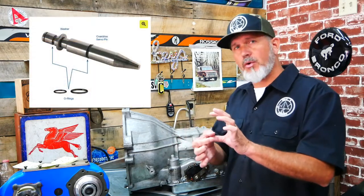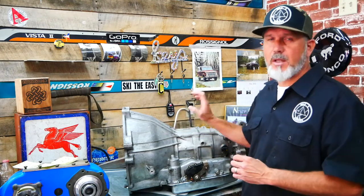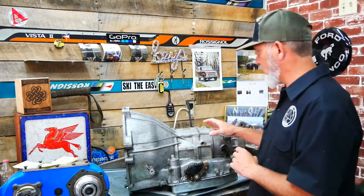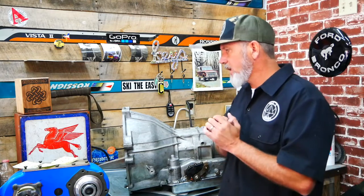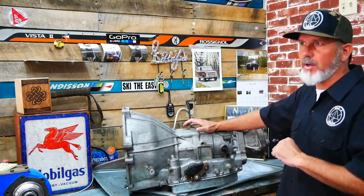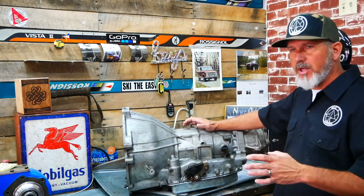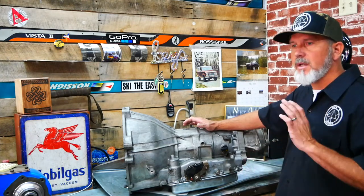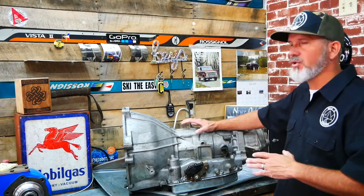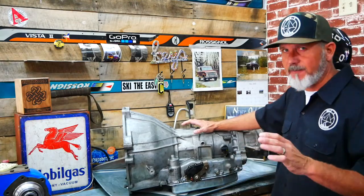When we rebuilt this, we actually put in a fix for that — essentially O-rings that go into a new servo pin to help keep the pressures in the case higher, eliminating the opportunity for pressure loss to the clutch packs. We also switched out the tail shaft before reassembly. Now our 4R70W is completely rebuilt and ready to be mated to the Dana 20. Part of the reason we wanted to purchase this Bronco is because it already came with a 1997 Explorer powertrain, and we wanted to keep the Ford factory fuel injection and transmission control together so it would drive similar to a new vehicle.